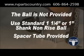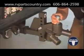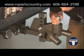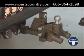The hitch ball capacity must meet or exceed the gross trailer weight rating. Install the hitch head assembly to the receiver hitch mount with the bolts, nuts, and washers provided. The hitch head assembly may need to be moved up or down on the hitch mount receiver later to raise or lower the coupler height.